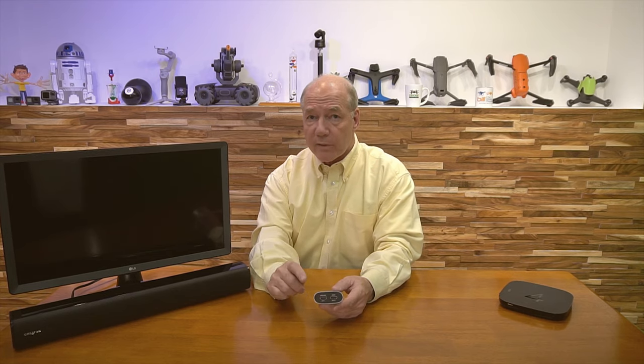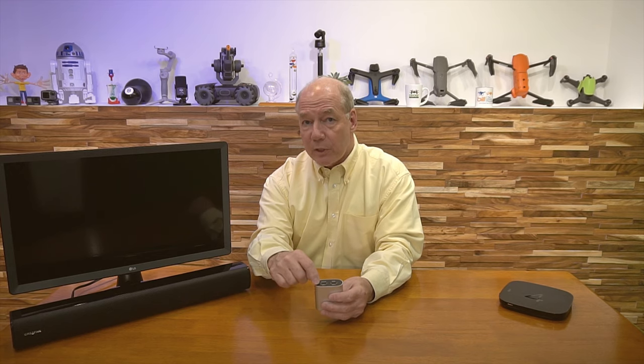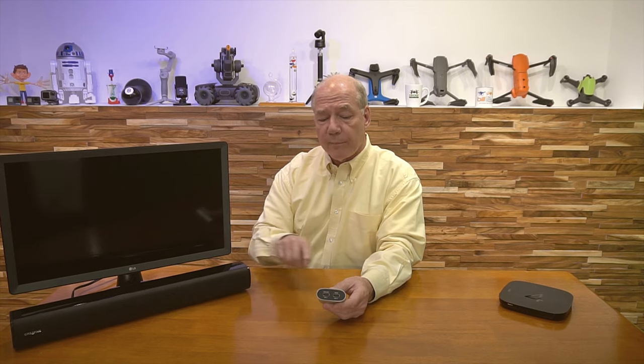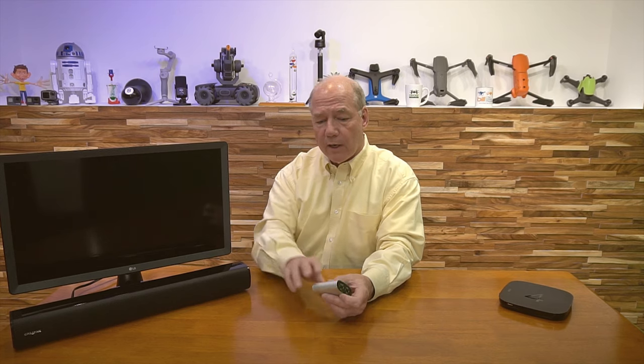So in that scenario, you'll connect up the media player to the HDMI input port on the unit, and in the rear, there are two more HDMI ports. HDMI 1 will connect up to the monitor, and that is going to transmit the video to the monitor in full 4K ultra-high definition resolution, so it's going to give you the exact picture you'd get if you connected it up directly. But the important thing is the HDA 927 strips the audio from that media stream and outputs it through that second HDMI port. So you'll run another cable from that output number 2 to your soundbar, and that'll actually stream the audio to your soundbar, and you can use an older soundbar with newer equipment. So it really allows you to get a lot more use out of your older equipment.